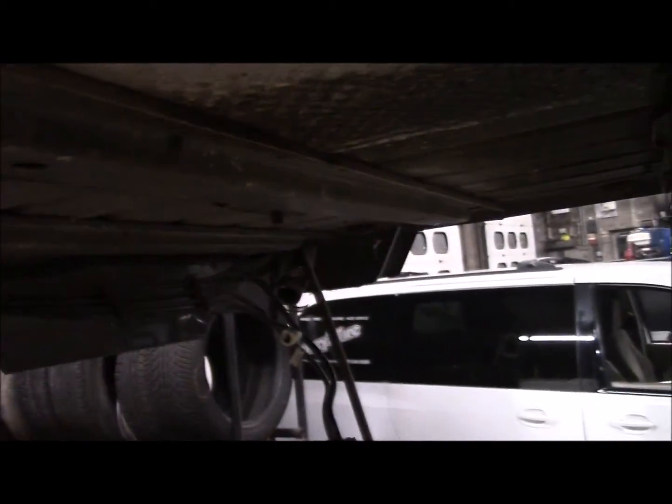Among the other things that are going to go is the evap canister. This 2003 has the evap canister under the rear quarter panel, where the '97 has it up under the hood. So since we're just using the tub, I'm going to use all the emissions equipment from the '97. This can go. It's just got way more tubing and wires than I need to deal with.